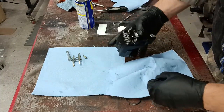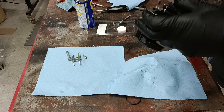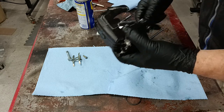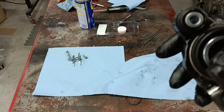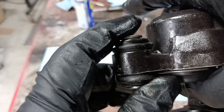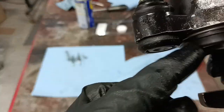Slide the new cap down over the bleeder screw. We just run it down. We won't tighten it up yet. I made sure that these came apart and that this slide moves freely. I put some light oil in it. I didn't bother with pulling these apart because my kit doesn't have new ones. And if I had torn them, I wouldn't have a replacement.